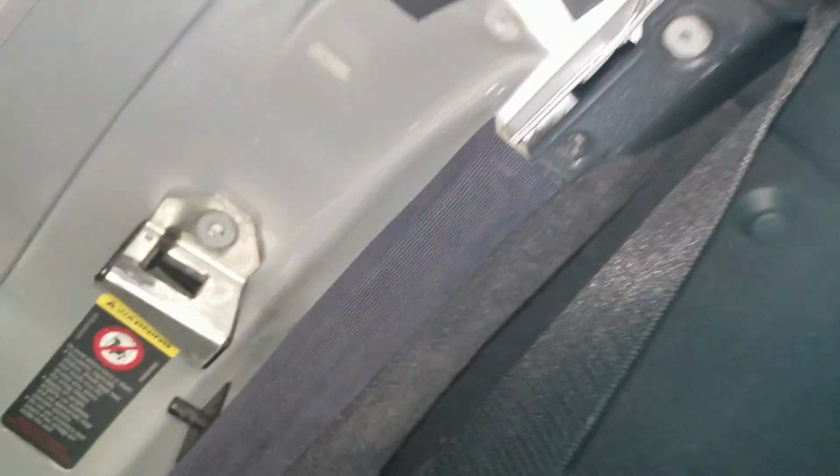To get back behind the seat to route the wire, the power wire, to the end of the trunk, these 3 screws here have to be taken out, and they're T9 screws. So after those are out, then you can pull this foam edging off, and then it exposes back behind there to see where the wire goes. So now with the plate off, you can see this just it's like foam. It just sort of clamps on to the edge of the car, and it can be pulled off and pulled back. And after you do that, then you can get back here and see.